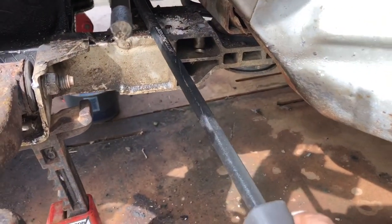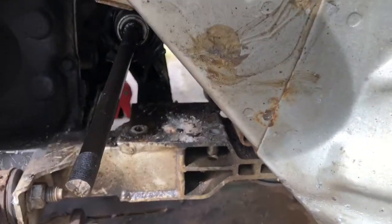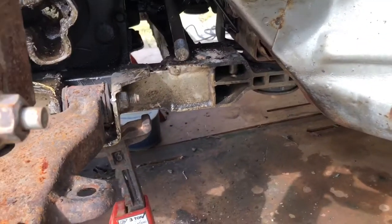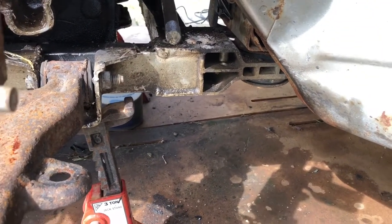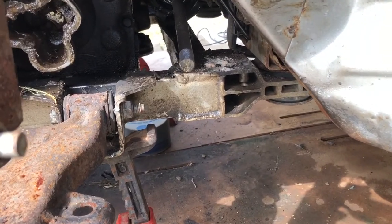What I found was that this whole steering rack is jacked. The bushing is broken. I had trouble getting the boot off, so I just figured since I had a new boot I'd cut it off — and when I did, power steering fluid came pouring out of it. So this power steering rack is shot. Since I have the power steering rack that came off the black car and it still works, I'm going to put that in here just to get it moving around the lot.